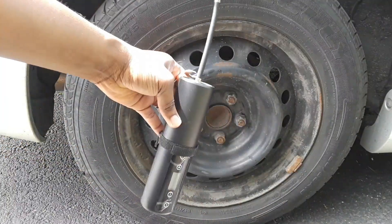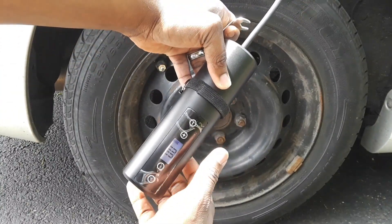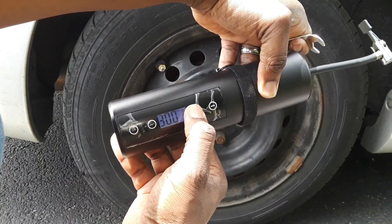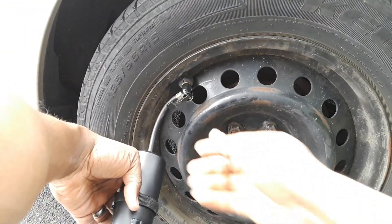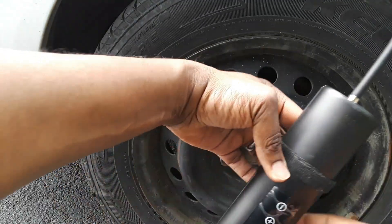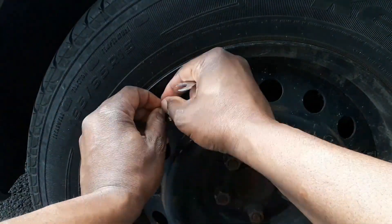I have a portable pump that I'm going to use to put pressure back in the tire. I've preset it to 32 psi. Now the pressure is at 32 psi and it's shut off. I take it off and reinstall the sensor back in the tire, cover everything up, and go show you what I have on my dash now.